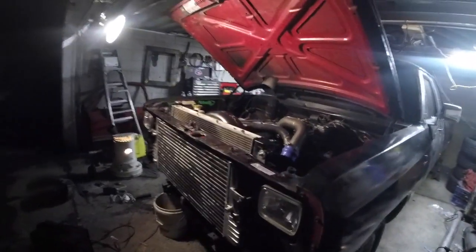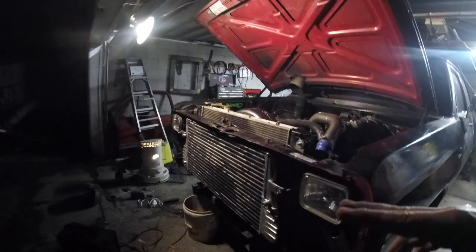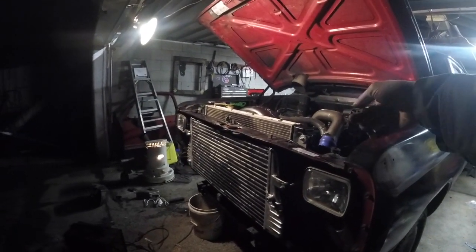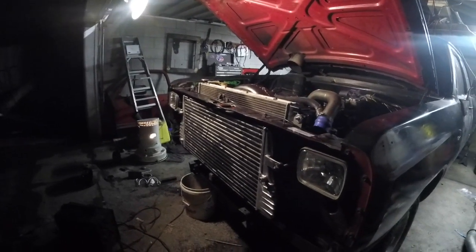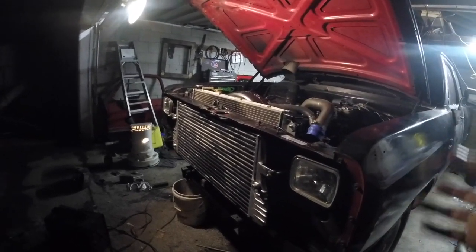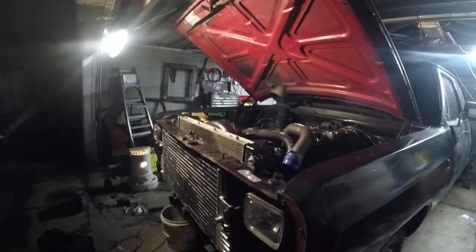It turned out really, really good — everything fits well. The only thing is you have to trim the shroud; most people end up cutting it and leaving the intercooler hanging out the bottom. I'm not going to cover that in this video but I will do an update video once the truck is running to give my opinion on how much better it operates. I'm assuming it'll help keep it cooler since it's an all-aluminum radiator that's way bigger than the first gen one, and it's apparently a dual-flow system. We'll clean up the intercooler, paint all the brackets so they don't rust, and then deal with the fan shroud.